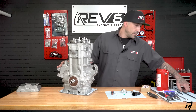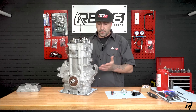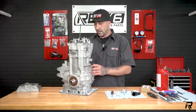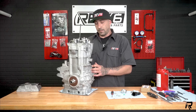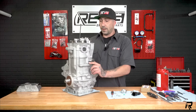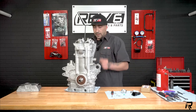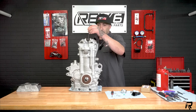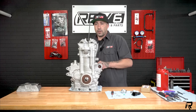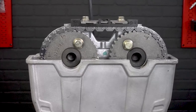If you have the flywheel off, the book tells you to go to your crank position hole and rotate the engine over. When you find top dead center, you'll see a little mark through the window with a little V — that tells you top dead center. The problem is the flywheel may shear. Instead, I rotate the motor over using my timing tool, which touches the top of the piston with nothing that can flake or damage it. As you rotate, you'll see the I and E marks lined up on your cam marks — you're at top dead center on a 570.